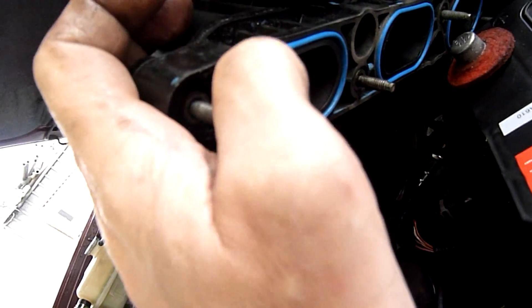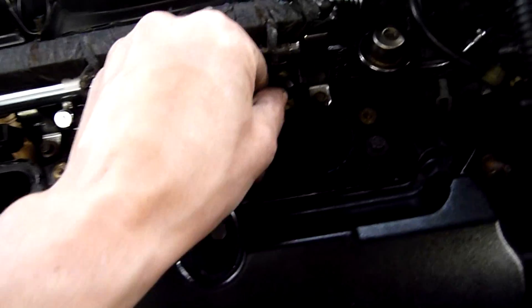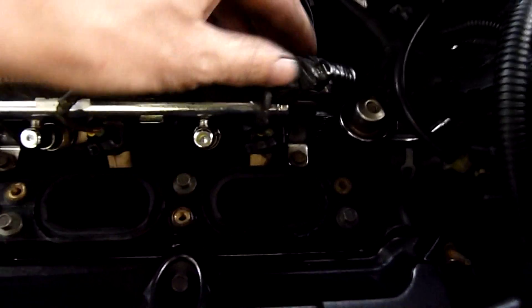With the inlet off, I can see the seals have actually been done. Somebody's Blue Maxed it at one point, but that was a bit misleading because it has been replaced - there are actual new seals in there. So unless the intake's cracked, I'll do a thorough inspection, disconnect these vacuum lines. I like the way these are all cable-tied on the injector plugs - I'm guessing there were problems with them coming off. I'll be careful not to drop debris down the intake.